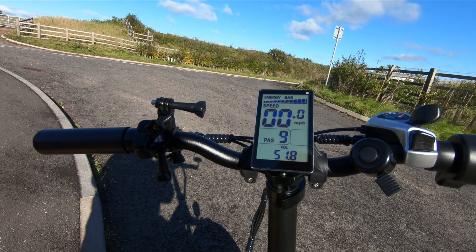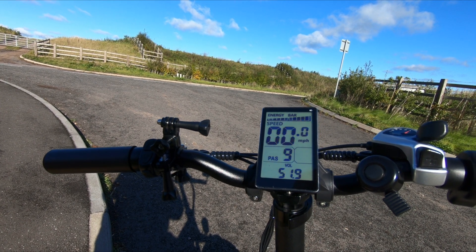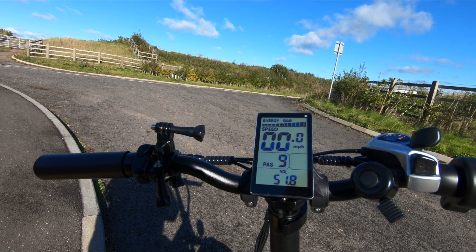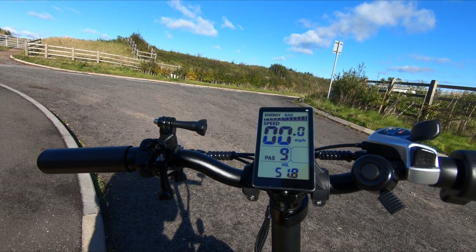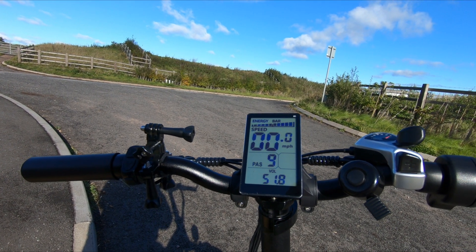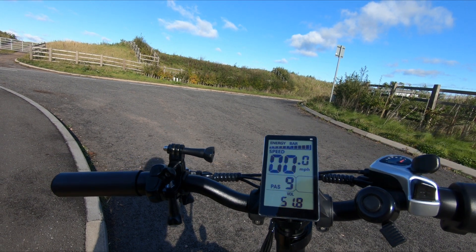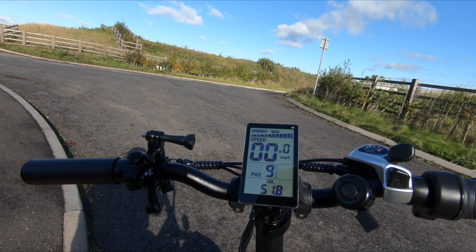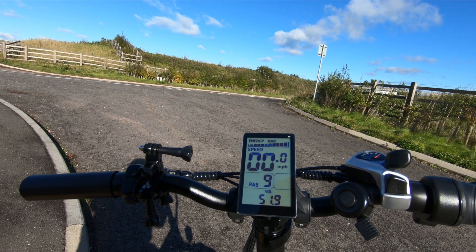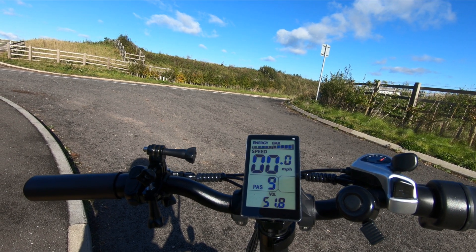The only issue I have with it is the nine power assists that you now have — it seems too many to deal with. I did set it at zero and that gave me three power assists. I think the top speed was about the same, but I found three not enough. So for the time being I'm going to keep it on this, so I've got nine assists. I may revert back to the original — just for the sake of a couple of miles an hour, do I really need it? I was quite happy with the top speed of 23 miles an hour. Anyway, it does show that there is another setting you can adjust that will make a difference to the speed of the bike.